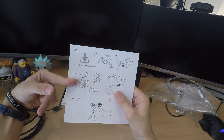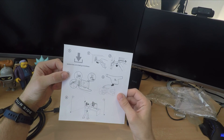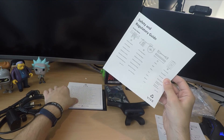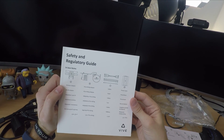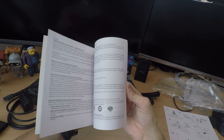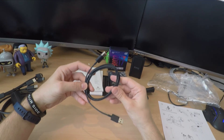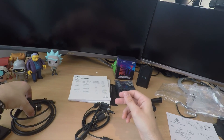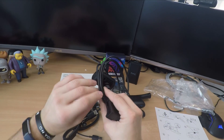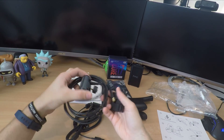Inside the box you also have some basic instructions which basically say: download the software, take your computer apart, and install the card. I'd recommend making sure your computer is cool before you do that, and use an anti-static wrist strap so you don't damage your computer with static electricity. I also found the instructions on the website weren't that great. The PCIe card is basically a plug-and-play system — it's a bit of a fiddle, and as I said you need to make sure it fits in the relevant slot. It took some jiggling but I got it in there, and I'm happy to confirm it worked without any problems.